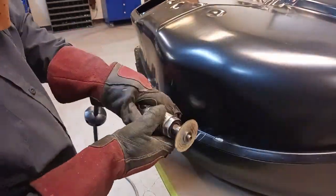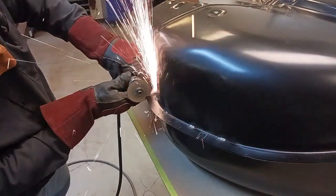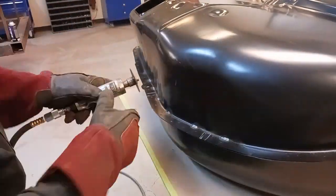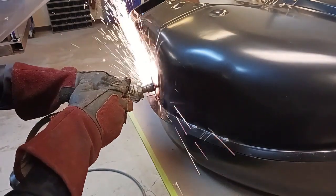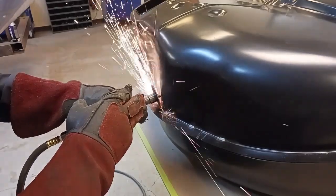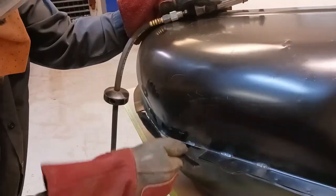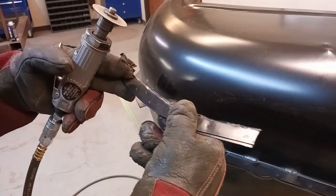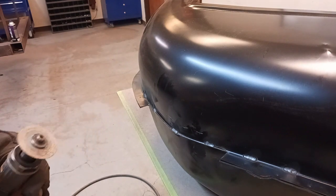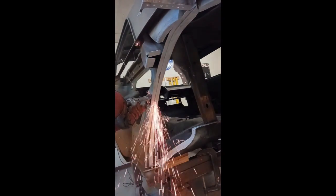There are several pieces that sandwich together in that area — they come together in this area where I'm cutting out — so it's much easier to trim that little piece so that the wheelhouse slides in easily. I've already welded the inside and put those welds in to give it strength, which is going to make the installation so much easier. Otherwise you run into an unnecessary mess.